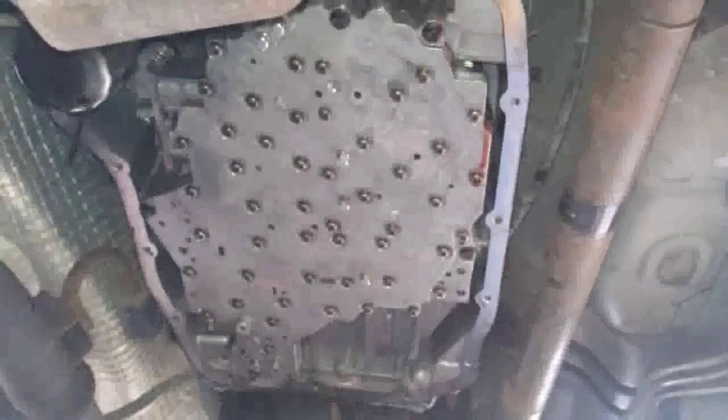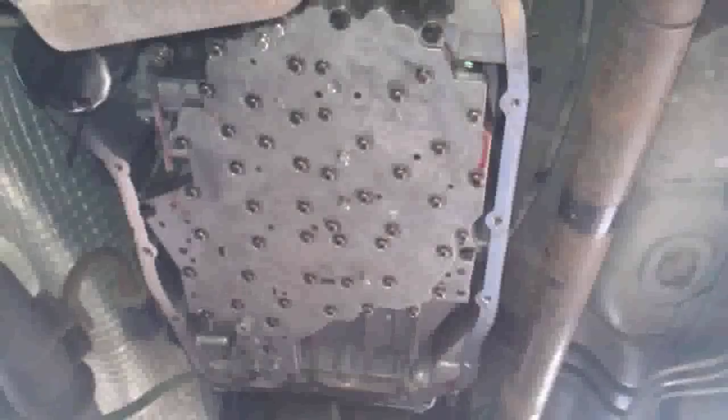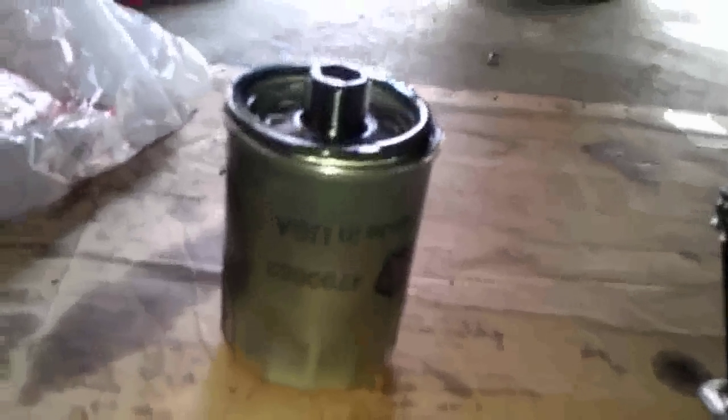Now that's done, I'm going to resume my transmission fluid change before getting to taking this filter out. I'm going to clean my pan and scrape off whatever residue is left from the previous gasket. My phone died so I wasn't able to finish filming, so this is my finished product — I've got it back on. From where I left off, all I had to do was clean out my filter and pan, clean the magnet, and switch out my filter. This is the old one — that was easy. You just use the tool to twist the old one out and put the new one back in up to 125 inch-pounds.